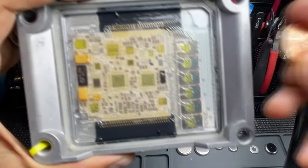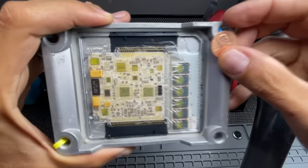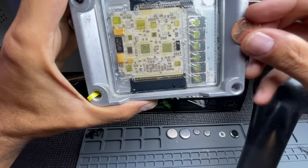Remember that clicking noise coming out of the throttle body? That's a textbook symptom for a failed engine ECU. However, I just had this entire car apart and figured there's no way I have a failed engine ECU - we've already replaced one in this car. ECUs don't fail a lot, or do they? The Ferrari 360 is really interesting and the ECU's construction is much different than pretty much every other modern car. Before deciding we have an ECU problem, there is a mechanical test you can perform with no special tools to see if we indeed have a failed computer.